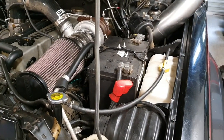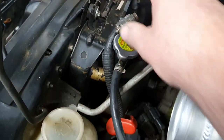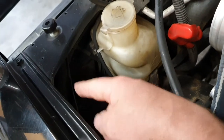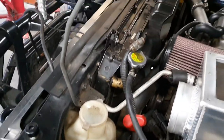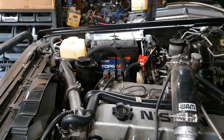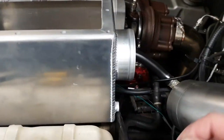Battery out and on the bench, earth cable disconnected. The main battery cable runs through here — it's too dark to see — across there, over that way somewhere. It's going to join in with the battery cable for the other one, so I've got to pass that back through all the front of the car and shorten it up to suit when the second battery goes over there. I'll wait until we've got this all under control before I do that.